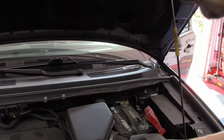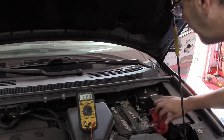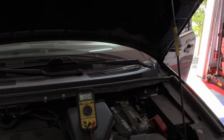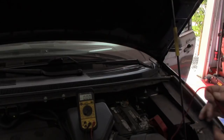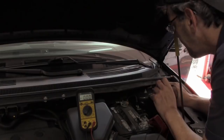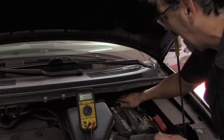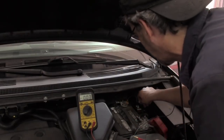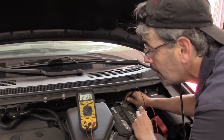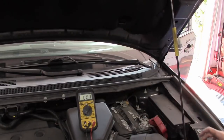What do I always say? Get your baselines first. We have a situation where we aren't having the issue. We need to see what those baselines are when we don't have the light on. This also really helps confirm the fact that we're going to have possibly some kind of wiring problem if this alternator and battery are good. This could be as simple as just a loose battery cable or something, but I'm sure they would have found that at a shop. So I'm going to measure at the terminals on the battery. We can see 14.2 volts. This alternator is working — that's all there is to it.